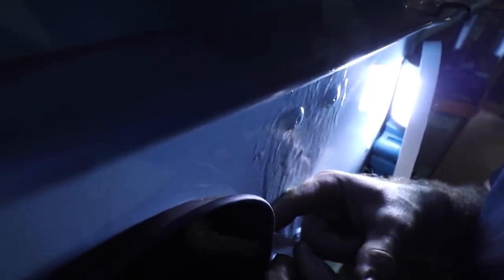I leave the weather stripping backing on so that I can slide it in the gap. Then I pull it off slowly and hope it doesn't rip, and it sticks perfectly to the weather stripping underneath it. Perfect. Right there, it'll seal that little bitty spot. We don't want to leak, so we just reinforce a little bit. Okay, I can't hold the camera anymore. Then I push on the top corner and Brian screws it back in.